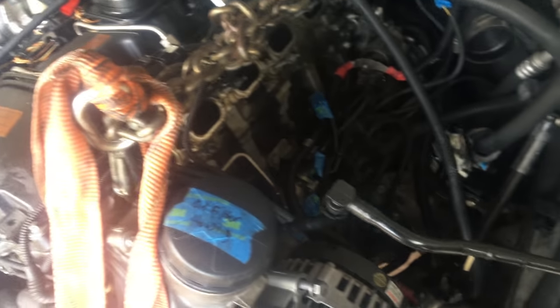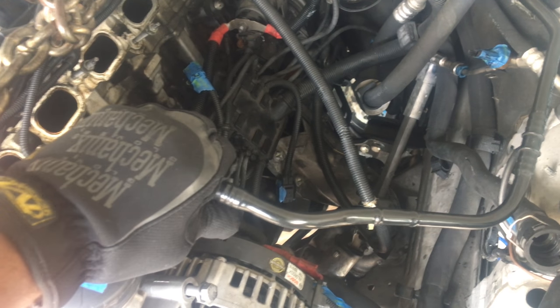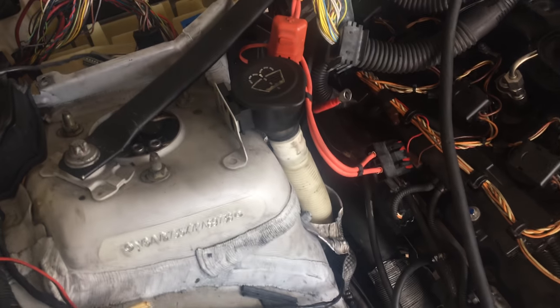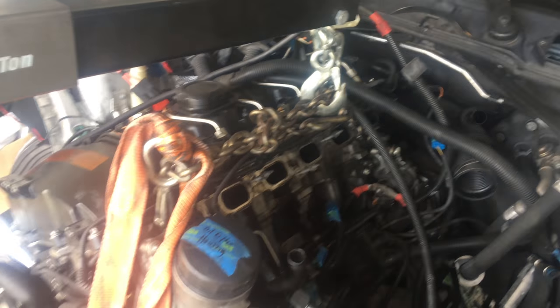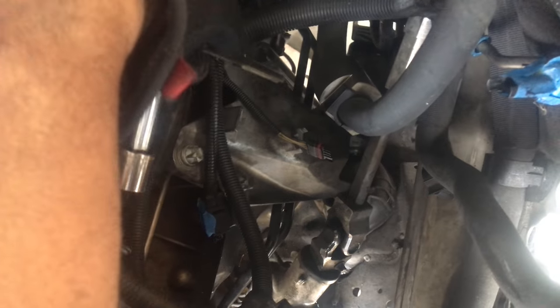The bolt's off now — everything should be off. I'm going to double check everything, make sure I don't have anything missing. The only thing I noticed was this one right here — the most blatantly obvious piece and I missed it. Just push in and then pull up and it comes right out like that, and just move this off to the side. Other than that, everything looks good. I'm going to start lifting the hoist up and pulling it out. I'm using my second jack on the transmission to try and leverage the engine and help lift it out. Taking out the engine, I noticed I do have to take this bracket off. I don't have the correct bit for it, so I'll use a 15, hammer it over, take those two bolts off, and take the bracket off — then I'll have enough clearance to take the motor out.